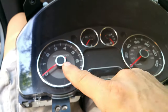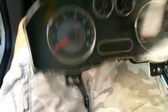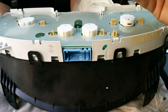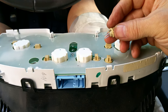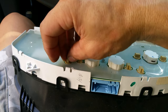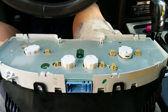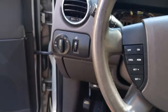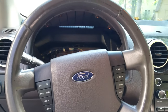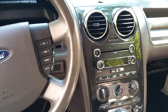If you're having issues with some of your lights being out on your cluster, that's how you get to them. You should be able to get these bulbs at any major auto parts store. Just screw them back in place — they pop out of these little sockets, pull the bulb out, push the new one in, put it back in, and it'll click into place when it's in properly. Then reverse what you did and test your switch to make sure everything's working again. We'll be doing a lot more work on this car — 2008 and 2009 Ford Taurus X. See y'all later.